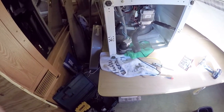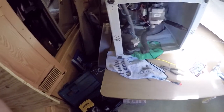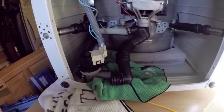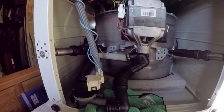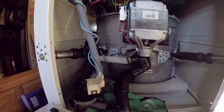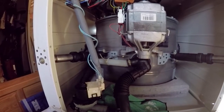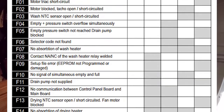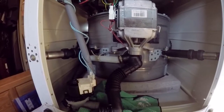Looks like I'm gonna have to get batteries and the lights are a little funky, but hey, what the heck. Let's get down here and I'll show you what's going on. It's my washer and it's been on the blink for quite a while. I had a suspicion that the pump was just full of junk from years of use, causing error codes on the front - an F10 and then an E05, which was for the pump.